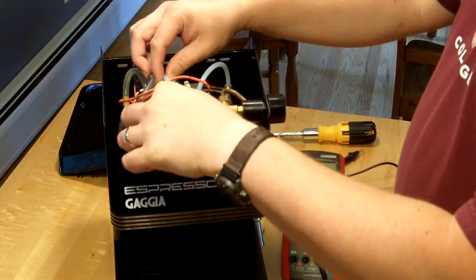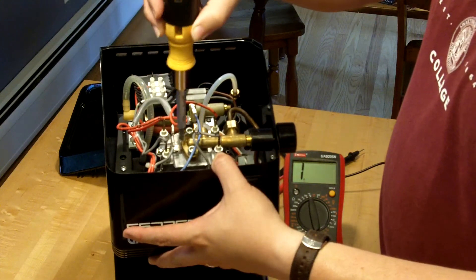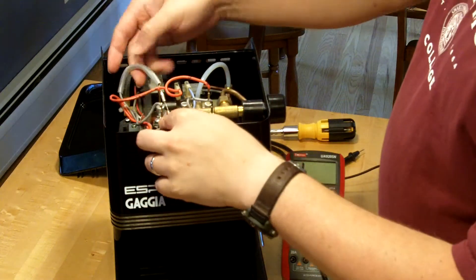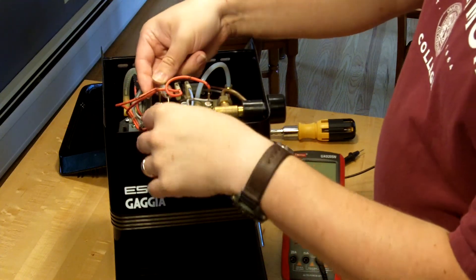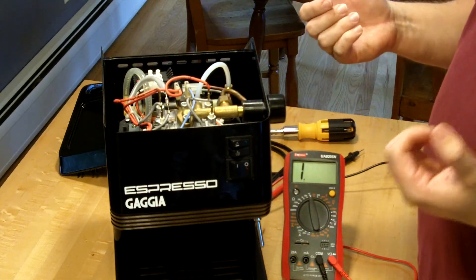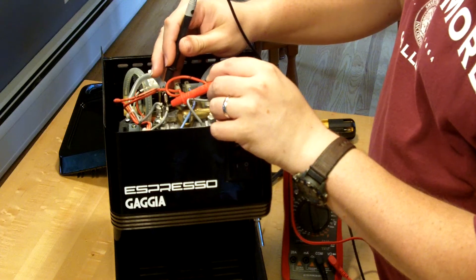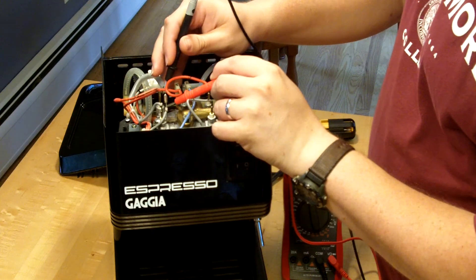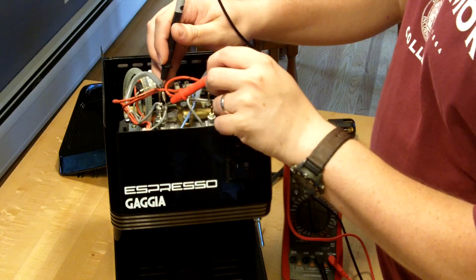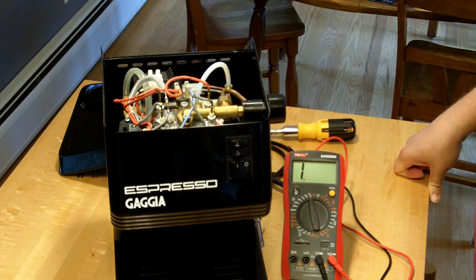So the next thing I'm going to look for is this thermal fuse. I had to take off a little zip tie and slide back a piece of plastic tubing in order to expose this little thing. This is a thermal fuse that fuses at 184 degrees centigrade. If it's good, it should have continuity and pass current from one side to the other. Problem is, it doesn't. Just to check — that's fine if I'm on both contacts of one side, but as soon as I'm trying to pass any current through it, it's not going anywhere. Luckily, this is a cheap part, so I'm going to order myself a new one and I should be back up and running.